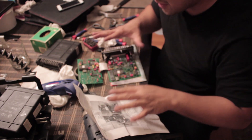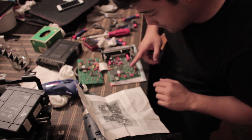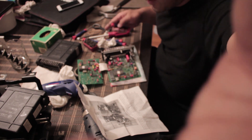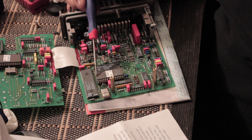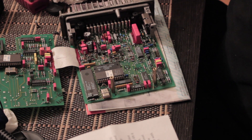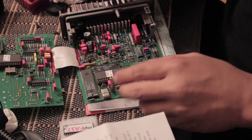It comes with installation instructions. For this particular style chip, this chip stays intact — the one you want to replace is this chip here. It's really important to pay attention to where the indent is on the chip. See how it's indented on this side? When we install the Digi chip, we want that same indentation facing that same side — otherwise you'll short the ECU. I've already done that before with a different chip, trust me. The key is to just work very slowly.